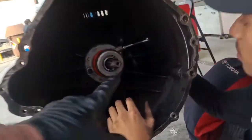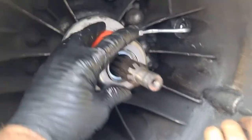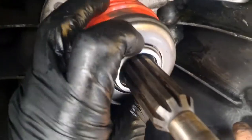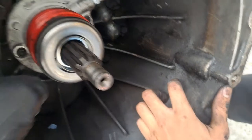All right, that's good. Now look up specs. Where's it called to grease? I'm sure it's going to have us grease the splines. It might even have us grease this sleeve. See that sleeve? That's a friction point. So I bet it's going to call for grease there, grease there, grease here. There is no pivot because the slave is concentric. And then we'll just clean this up.